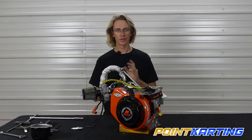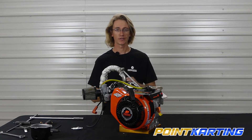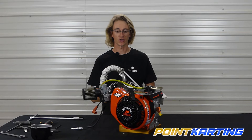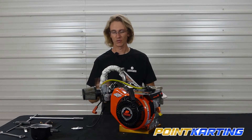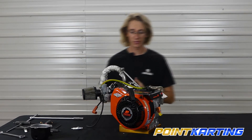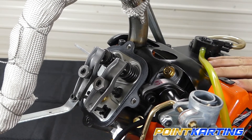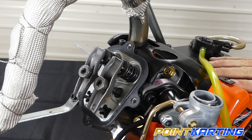For those of you not familiar with the four strokes of a four-cycle engine, we're going to have a separate video covering the combustion cycle with a link below. For those who are familiar, let's briefly review those strokes while we pull the cord and go over how to find top dead center of the compression stroke — that's where we're going to set our valve lash. Simply grab the pull cord and pull. Here we can see the intake stroke, then our compression and power strokes, and of course the exhaust.